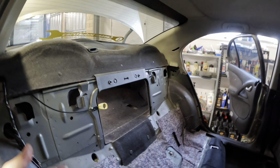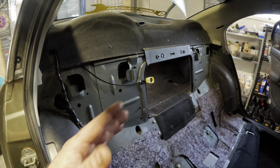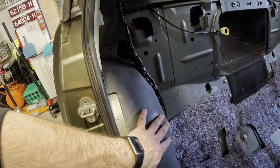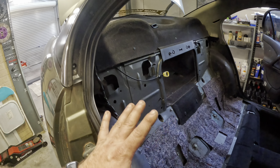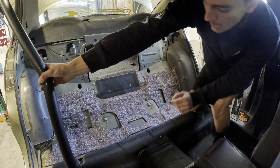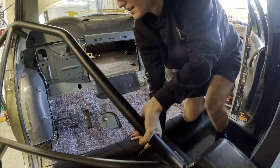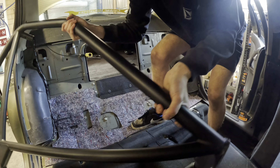So I've got a fair bit of stuff stripped out of the back — obviously the back seat is out, we took all the rear seat belts out as well. To get the retractor out you've got to remove the parcel shelf, so I ended up just pulling the belt out and cutting it, but the rear ones have been fully removed. I pulled the C-pillar trims back to get to the retractor bolts and then refitted the trims — I sort of like having some interior, so I don't want to remove too much. What we'll do now is sit the cage in and see what we need to remove and where we need clearance for the plates.